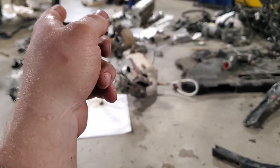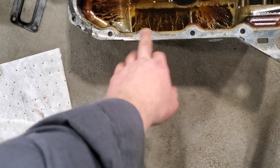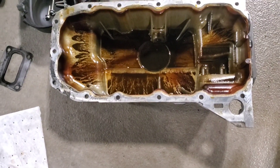I'm going to go clean out the old oil pan and get all that old material off. There are a number of ways to do that. If you use a soft wire brush — I know Ford doesn't recommend that — but it does really work. If you give it some surface to bind to; the manual specifically says not to do that, but they come back leaking if you don't. With just adhesive and no crosshatch or material taken off, it just doesn't work — they come back leaking.